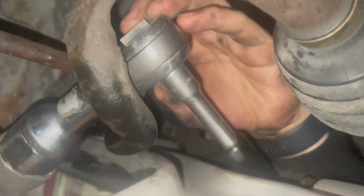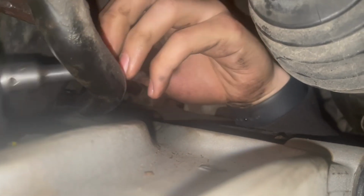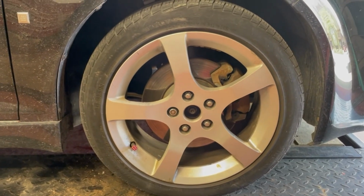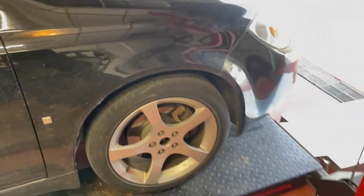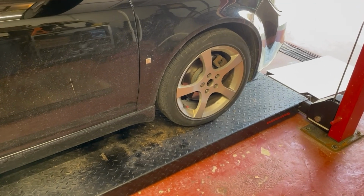These bolts are 41 foot-pounds, and we could really only torque one, because to get the torque wrench beside the torsion bar was almost impossible. So we got one on, and then using that feel, we used it for the other side, which we didn't use the torque wrench. I forgot to mention, before we torqued all of the bolts, we put the tire back on and let the car down onto the ground. This way we were tightening them up in the driving position, which is important.